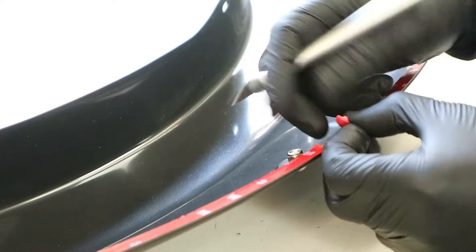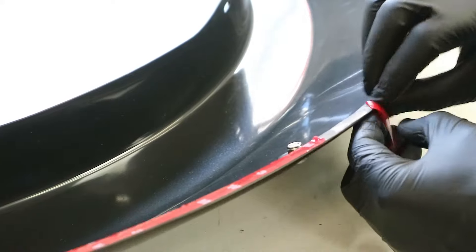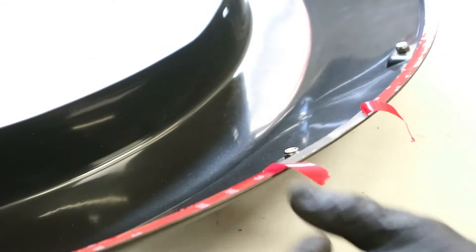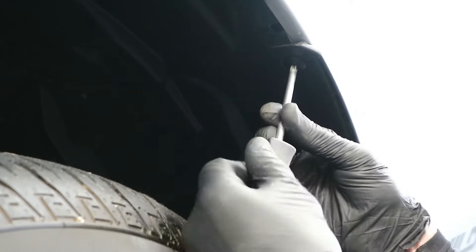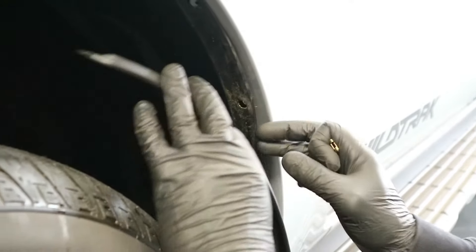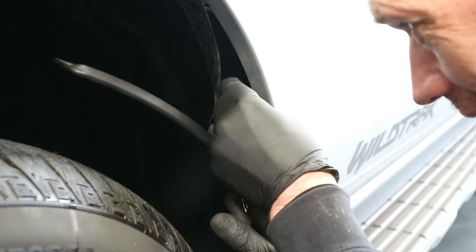Make a small incision of the tape to pull back the backing of the tape on each side — you'll see why we do this later on in the video. Unscrew and remove the tabs on the original arch which are holding the mud flap to the arch lining. Pull back the mud flap and the arch lining so you can apply the spire speed nuts.